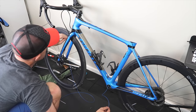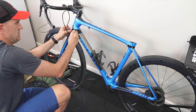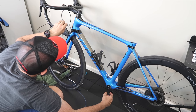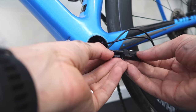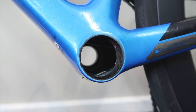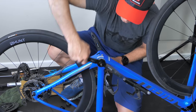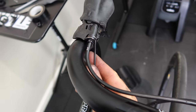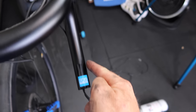There's a lot of open space in the down tube so those little cable ties stop things rattling around. Di2 end plug in and that's slowly fed up. Did I mention the Park Tool guide cable is absolutely brilliant? It's fantastic — saves a lot of time. With that all in place, the four port junction box is tucked in there, hidden away. Bottom bracket shell put in place, bottom bracket pushed back in. We have that lever plugged in, with the internal cable running all the way across, down into the wireless module and then into the junction port.